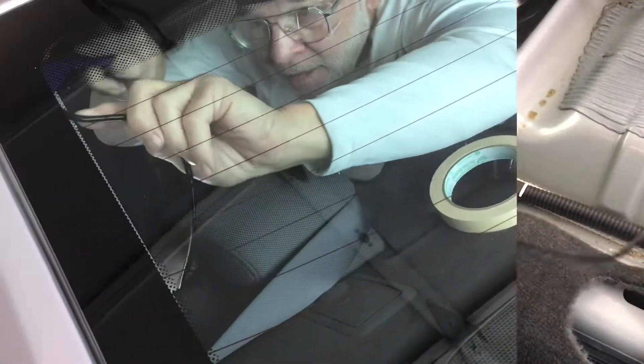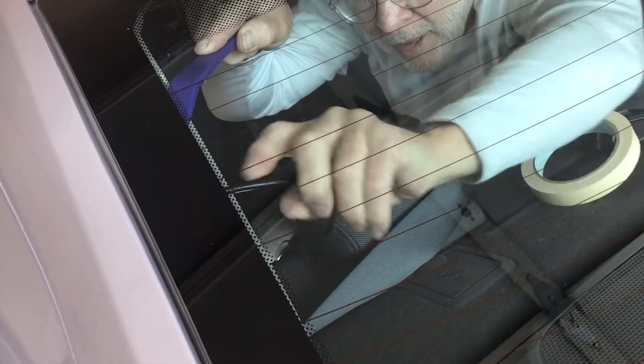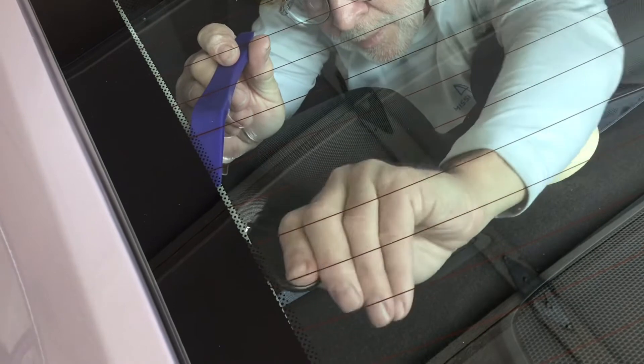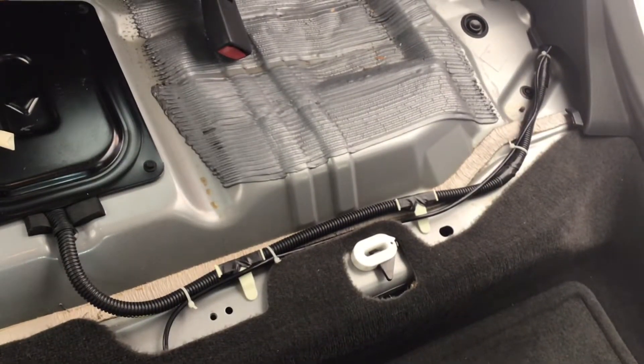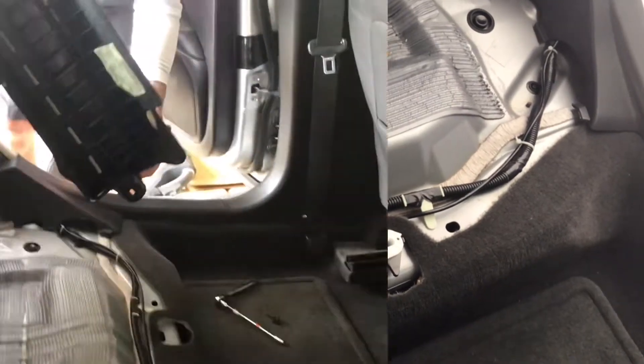With the camera mounted on the back window you can start to feed the cable across the edge of the roof liner and down the side of the glass. Here you can see that using the trim tools makes it a lot easier to lift the trim to hide the wire. Same thing along the edge of the rear deck valance. Once you get to the area underneath the seat, use zip ties to attach it to the existing wiring harness. I'm pretty happy with the way it looks.